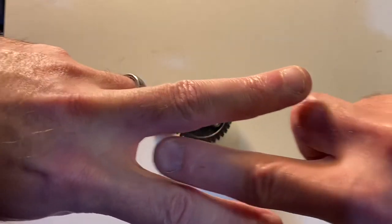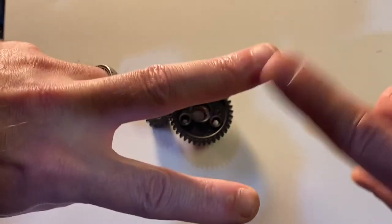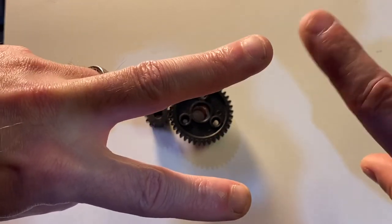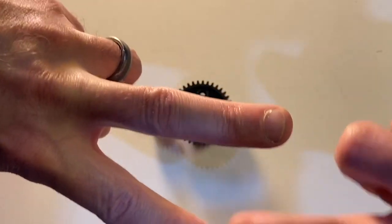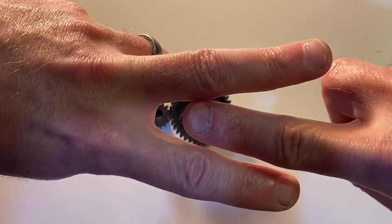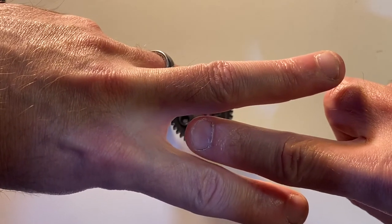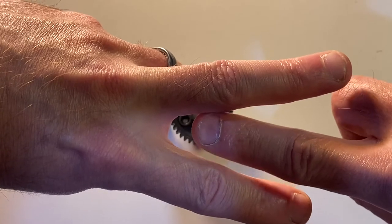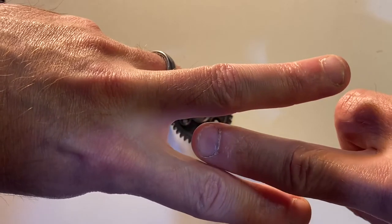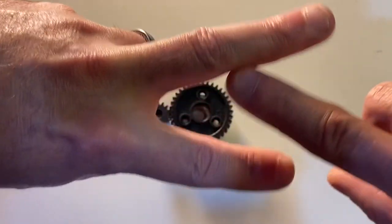You don't want to wedge it in there and create friction. If you're too tight, and if you're too loose, the gear is banging and slapping and it basically just chisels out the side of the outgoing gear, and on the incoming it chisels it out too - that wears your gears. The ideal mesh is somewhere in between where you've wedged the gear in and then back it out just enough to where it's free with a little bit of rattle and the tiniest little bit of movement. That takes all the friction out from the wedge but leaves it engaged.